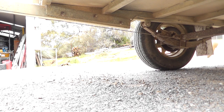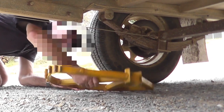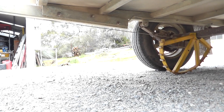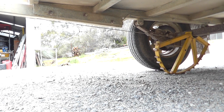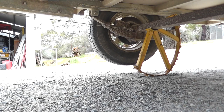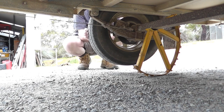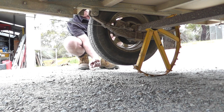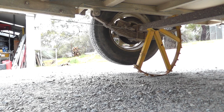Here you can see me fitting it on one side of the trailer. As you can see, it slides under there quite easily, and those rods are there to stop it from sliding forward when you drive forward. It very easily cams the wheel up off the ground. You need to calculate the height — it's not overly difficult. You just make sure it sits about four inches off the ground. I can spin the tire with clearance all around and underneath.